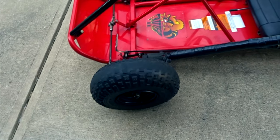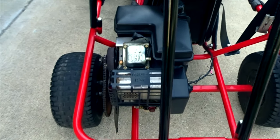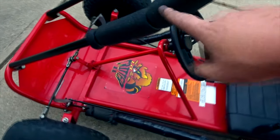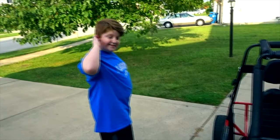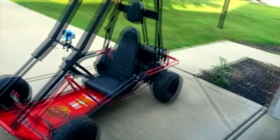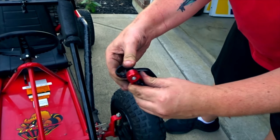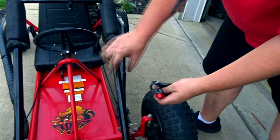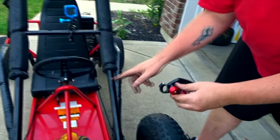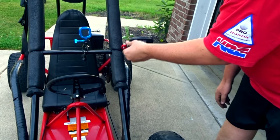If you guys want to see us do the full tune-up kit, subscribe to the channel. If you guys want to see us add mirrors, we're going to add mirrors to the front of this thing. We already have mirrors but they're the wrong size - I just figured this out. My intent was to have these mounted on the frame, but unfortunately this looks like a one-inch tube and the mirror mount might be three-quarter inch because it's too small. So somehow I need to make some sort of mount or adjustment. We'll make those adjustments sometime.